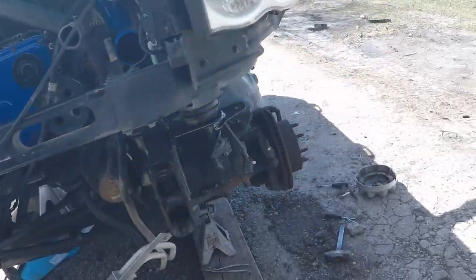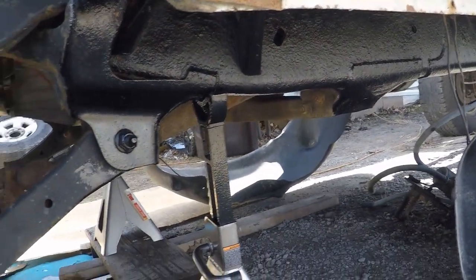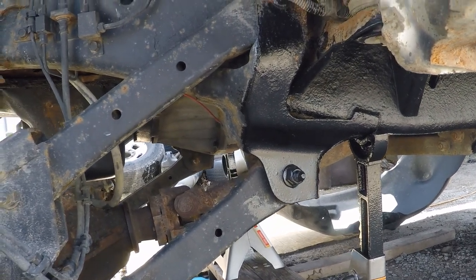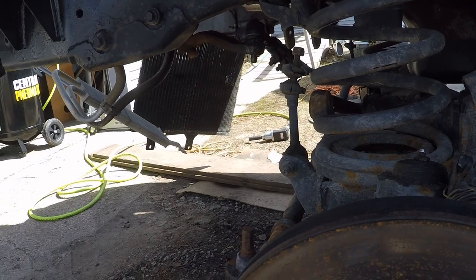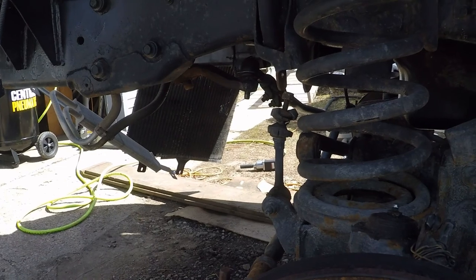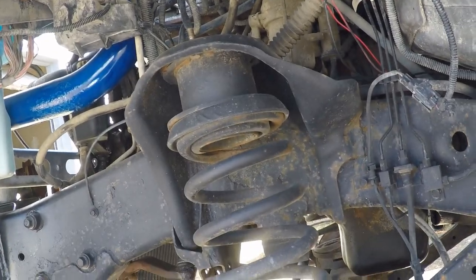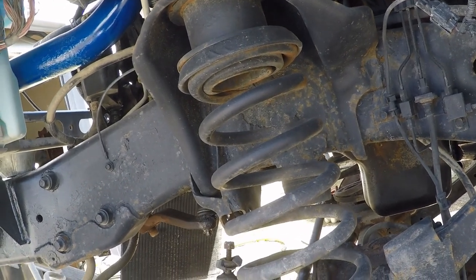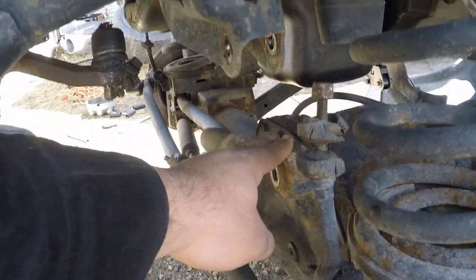Quick update — it's quite a bit later, a couple hours in, and we've got quite a bit of it taken apart. I'll use the instructions as a guideline here. We've got our shocks out and everything. According to the instructions, first you should install the transmission drop — but we don't have to. We detached our sway bar links — I just took the whole thing out to give me more room. After that we removed the shock absorbers, which I already did on both sides. And then we disconnected the track bar right here.